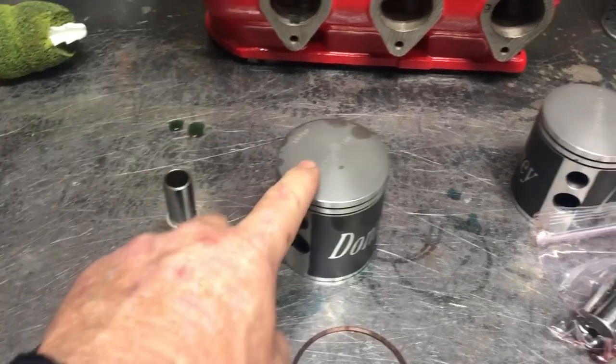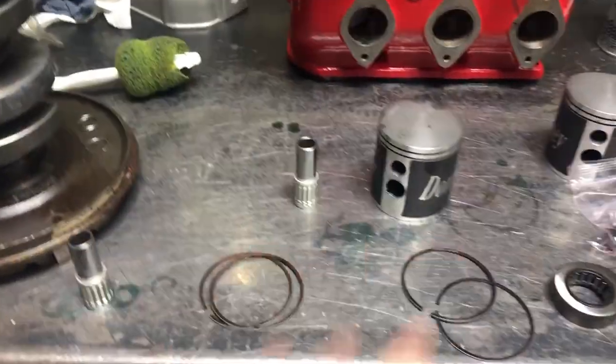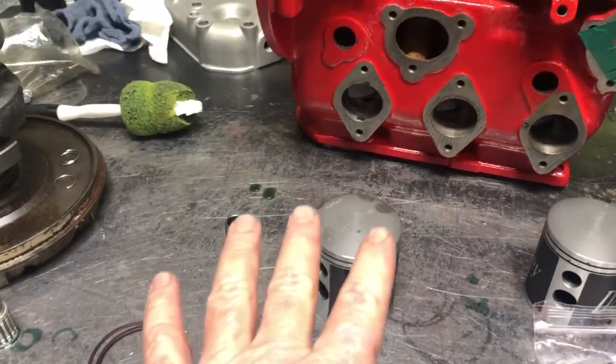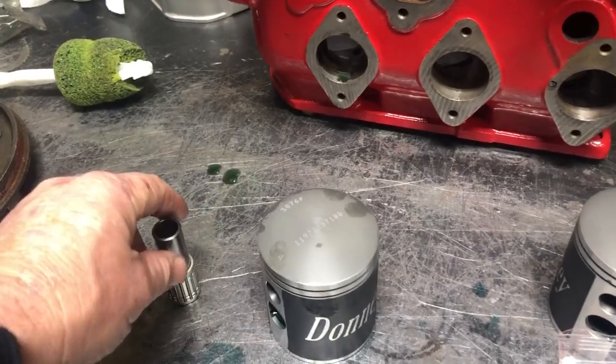A reminder that the wrist pins are fitted to the pistons. I normally don't sell pistons out of sequence, so if you've got a set of three, they're all going to be the same. But if you're changing out pistons sometime, the wrist pin and piston are a set — don't intermix them. There's a real slight difference, about six ten-thousandths difference between a few of them.